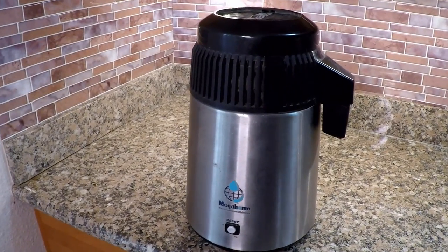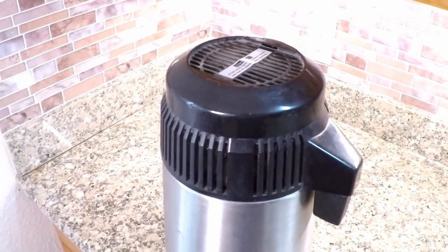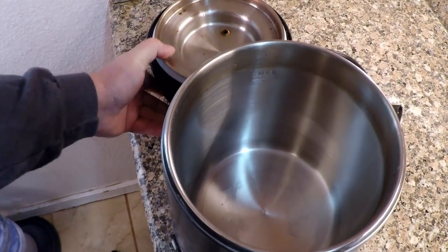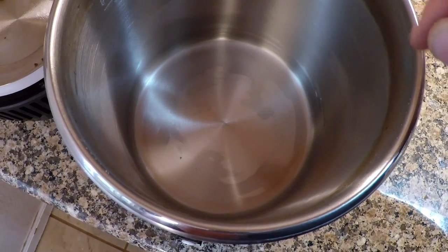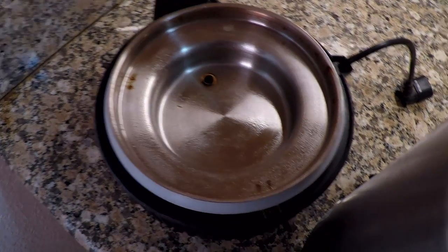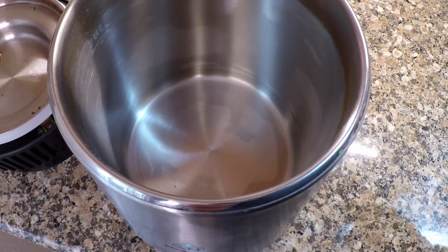If you want to learn more about any of the items I'm discussing today, check the links in the description box — I'll have a link to the distiller, the carbon pods, and some of the other items I mention. So let's take a look at the inside of the unit. All you do is pop the top and it fully removes. You can see the chamber there. There's one little speck of damage caused by myself when I used an abrasive piece of steel wool to try to clean up some calcium deposit, and there's also a little bit of wear on the upper lid in a couple spots. Overall not a big deal, but I can't emphasize enough that you never use anything abrasive to clean the unit — it's totally unnecessary.